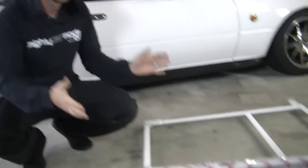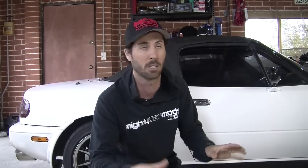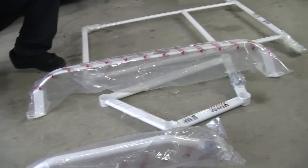These are the bracing components that we're going to be installing on the MX-5 today. Now, there are a number of benefits. Number one, of course, reducing your body roll during cornering. And number two, strengthening the chassis system. Because we're going to be connecting a bunch of the different suspension components together, the whole thing can work as one system. And each of the existing suspension components will do a better job of doing its job. That is particularly important when we've got a convertible like this, which has less structural rigidity than a car that has a full body.